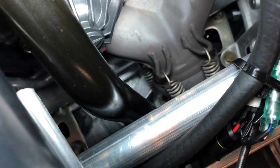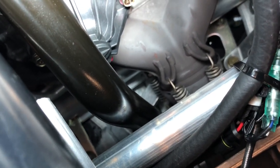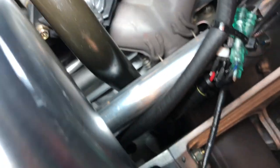So what they did is they got the drag link down low, and so they kind of put the weight down low. I like this setup better than the Pro-Ride. I think it's cleaner. It's kind of a more traditional setup for what they've been doing. If you remember the old Indies, they also had a drag link that connected the steering post to the steering frog. Anyway, I just think it's a cleaner design. So there's the stock pipe.